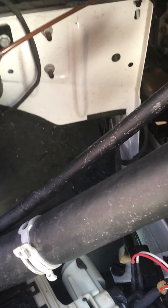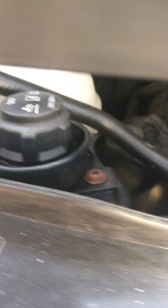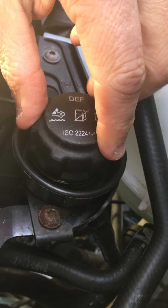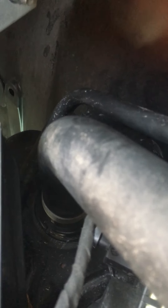When I dropped the tank I disconnected the fill pipe from the top and a hose which I believe is a vent. The connector down there is almost impossible to get off, so I left it on. What I did to drop the whole tank was come up where the fill is — there are three T30 Torx screws holding the bracket for the filler tube. I took those three out and pushed the filler tube down through the top so it could come off with the whole tank, because trying to remove the vent tube will likely break it.